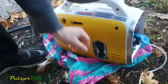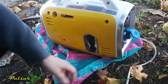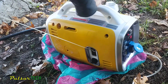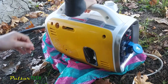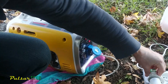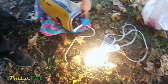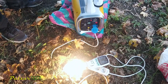Let's go through the starting procedure. First, turn on the power switch to the on position and make sure the vent on the fuel filler cap is open. If it's a fresh cold start, use the fuel primer pump to pump fuel into the engine — about five or six pumps should be enough. Then put the choke lever into the choke position and use the recoil starter to start the engine. After the engine starts, switch the choke lever back to the run position and it should run smoothly. It usually starts from the first attempt, though if it's been sitting a while it may take two or three tries. On new machines it typically starts right away.